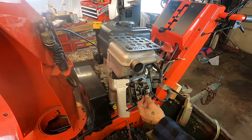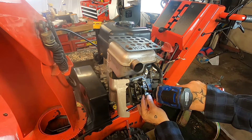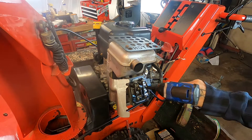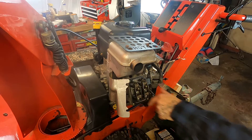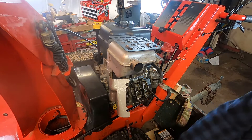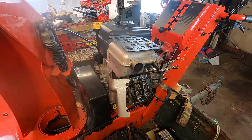Make sure we get our push rod in there and make sure it clicks at the bottom. Tighten this down. We want that nice and tight. Let's go ahead and find top dead center on the compression stroke. Quarter-inch extension method — put that down the spark plug hole and you can see the piston coming up and down from all the way over here.